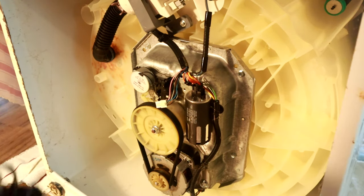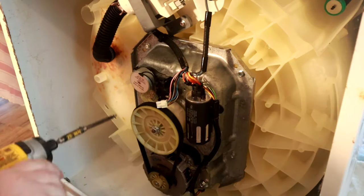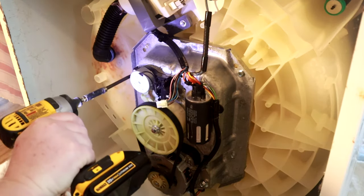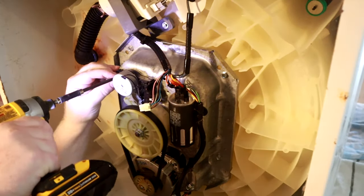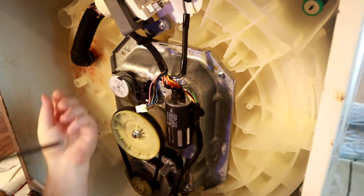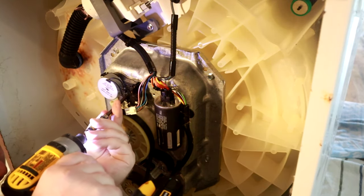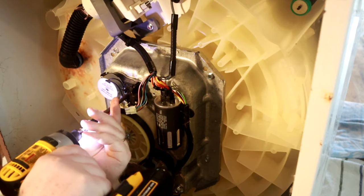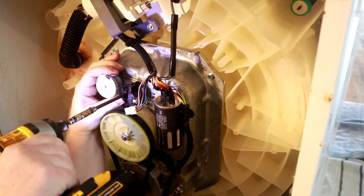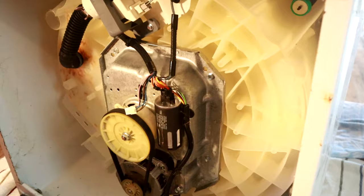All I've got to do now is pull out a couple of screws and we should be able to get this actuator off. The shift actuator is what actually engages the clutch for the spin cycle — that's why if you don't clean any debris out of that clutch you can still have issues. Make sure the clutch on the washer is moving freely. In fact, this is the best time to go ahead and replace that clutch as well. I'll leave a link in the description to where you can get the parts.